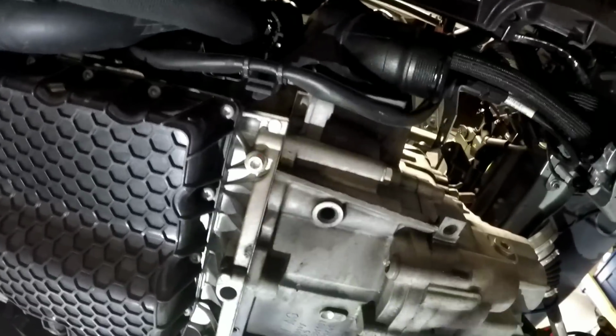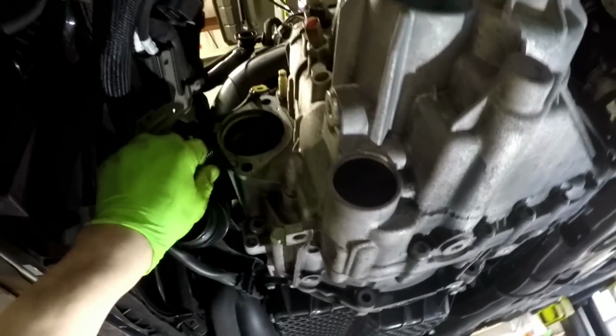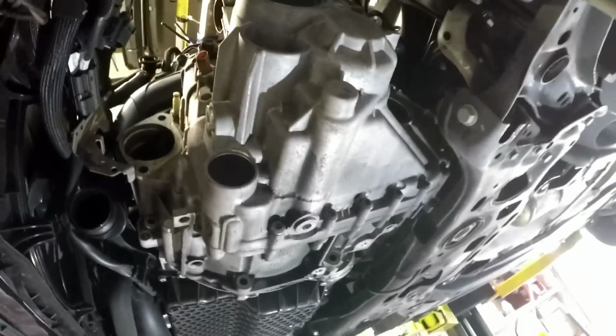I used a jack stand here once, or here, to support the engine while you drop the tranny. And you have to make sure you drop it low enough, because when you come down, you might hit this part. So you gotta drop it down like I did earlier. Another pro tip, move these out of the way, because this is gonna get hooked in here and you're gonna be stuck there fighting it by yourself and you're crushed to death. Well, if you do bench press it out like I'm about to. No big deal.